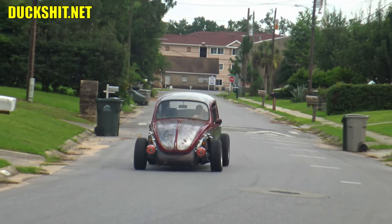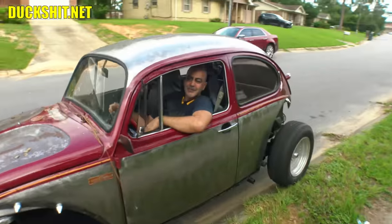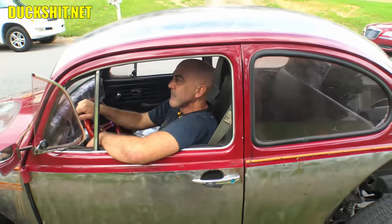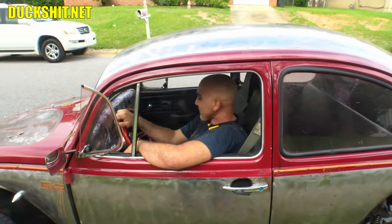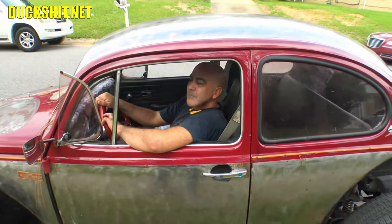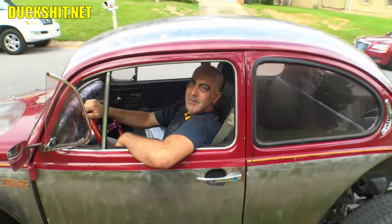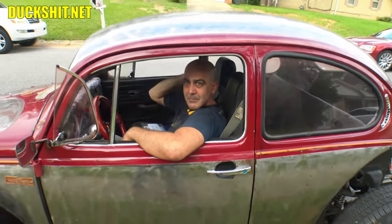There it is — power brakes, stops on a dime. That brake pedal has a little more motion in it than I'd like — that's because of the rear discs. We can raise that up with a residual pressure valve which would hold the pedal a little higher. Something I'm going to do on another car too. It's only like twenty-four dollars so we'll just install it. Otherwise it runs great — it just needs to warm up and is a little choppy as you probably noticed.